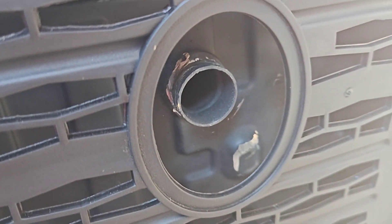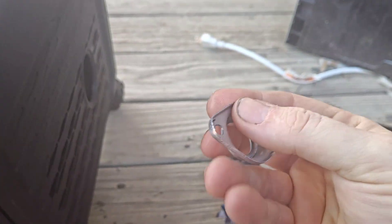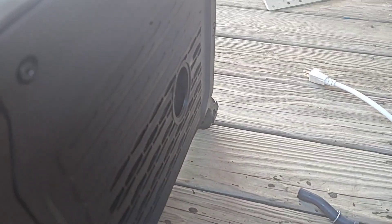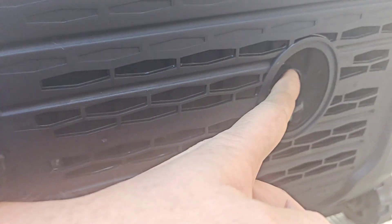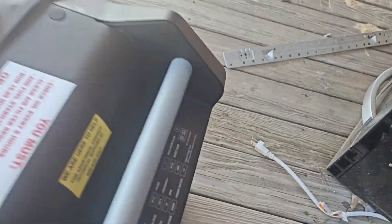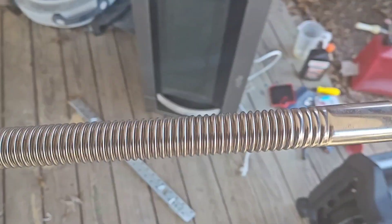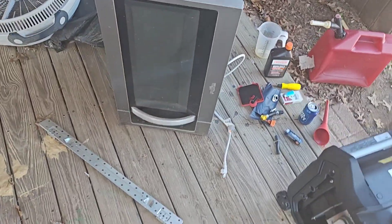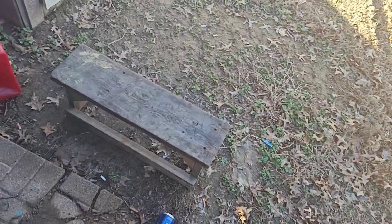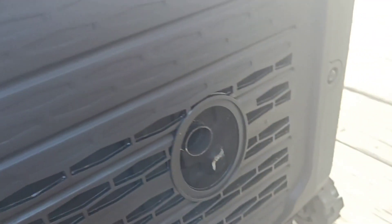The exhaust right here comes with a welded-on port shaped so a spark arrester piece can bolt onto it. With that piece welded on, there's a nub that will not stick out, but I needed that nub sticking out because I'm going to be running an extended exhaust pipe — something like this hose — and I needed something to clamp it to. If you're going to run an extended exhaust pipe, you'll probably have to do that same thing. It's got four spot welds; you just cut them off with a cut-off wheel.